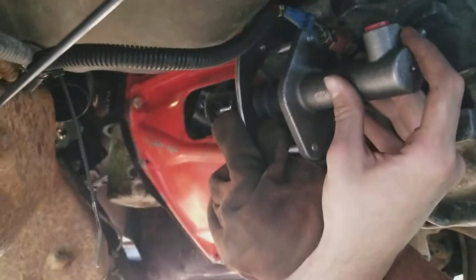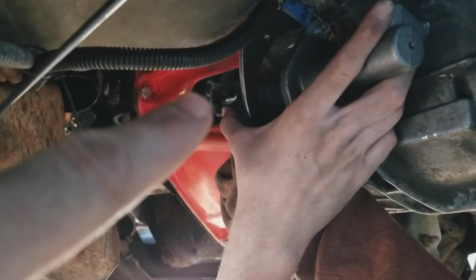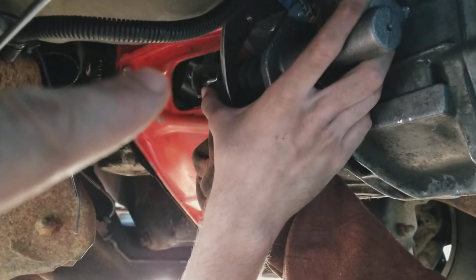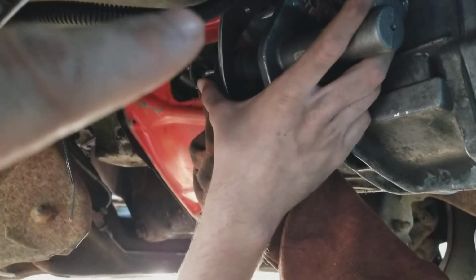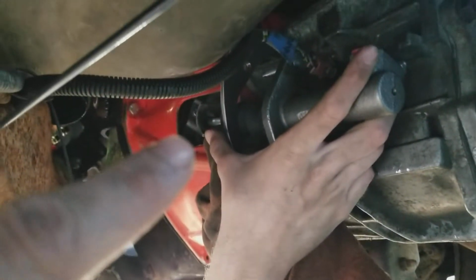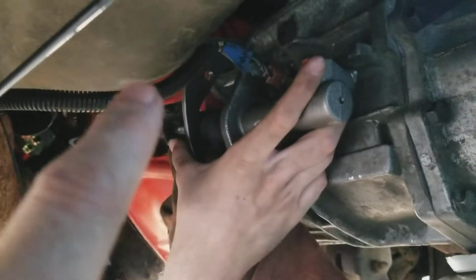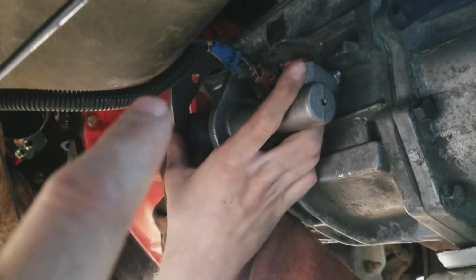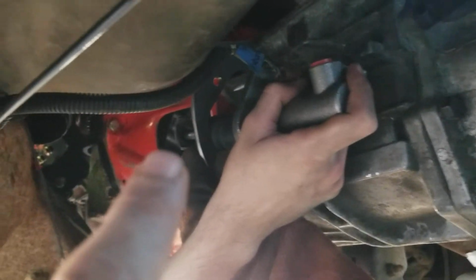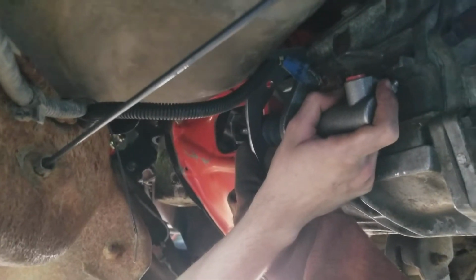And we think right now that there is not quite enough space from the bracket to the clutch fork. So if anything, we'll put some washers in here or something like that. We're not really sure yet. We haven't compressed it yet to see how it sits, but it's really not a big deal. But this is basically how we're doing it. What you could do if you wanted to is put a bend in your bracket so that that's not a problem. But this is a lot easier with some scrap steel laying around. Okay, so that's our slave cylinder problem.